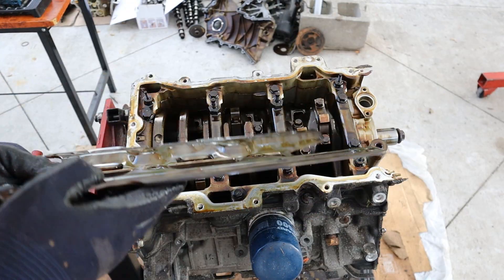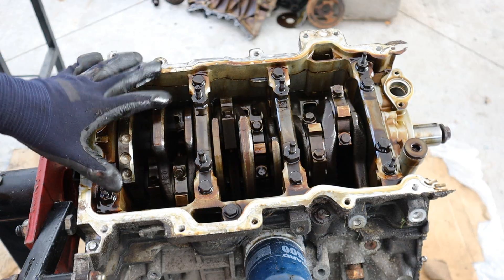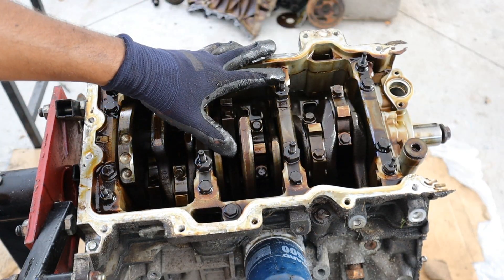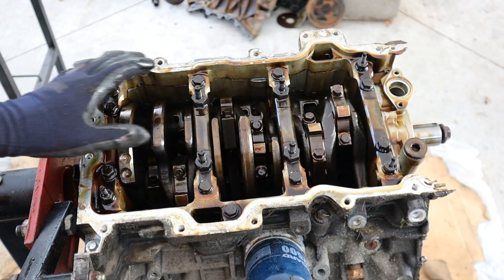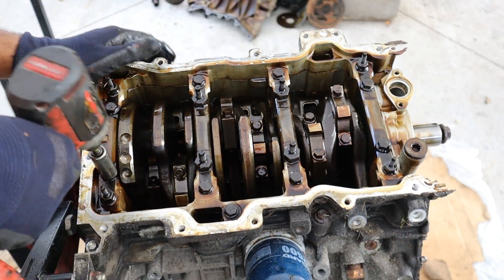This piece is a pretty thick steel and it's heavy — I wonder if it's actually meant to be a structural part. What's actually structural is that this entire thing is a ladder frame, forming kind of an upper oil pan that bolts to the block. That makes things a lot stronger rather than using individual bearing caps. There's a couple of 15s, 13s, and a bunch of 8s that run along here, so let's take those off next.